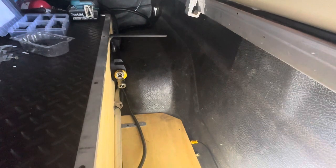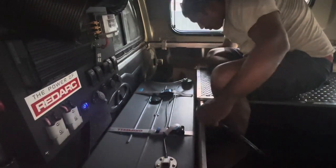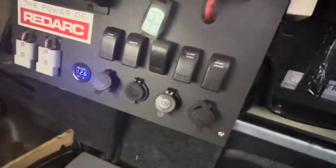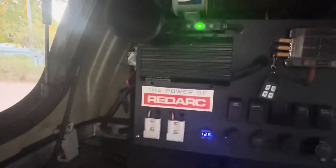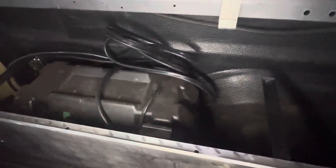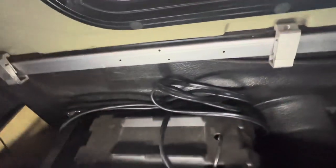I need to run this wire to the other side. I've run all the wire through here, behind my water tank. I'm not taking power from my 12 volt box — I have a 70 amp limit there, and this pump draws a minimum of 45 amps, so it might cut off. You also need to keep in mind, since I have an AGM battery not lithium, every time I'm running this pump I need to have the vehicle running.